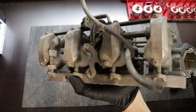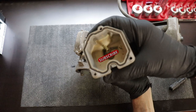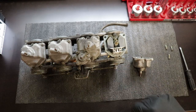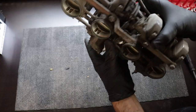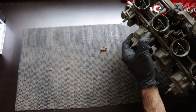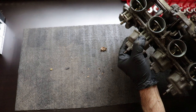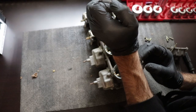Number one especially is bad. I'm not sure what's in there - let's have a look. Of course you want to get the float bowls off and have a look inside to see what you're in for, but I would probably put them back on after. I see a lot of potential for possibly damaging the float. You have to check the float height anyway, but why create work for yourself?